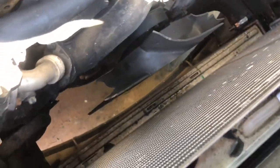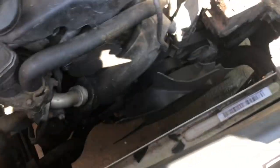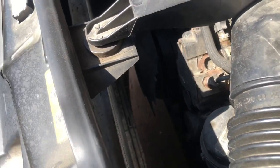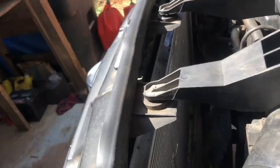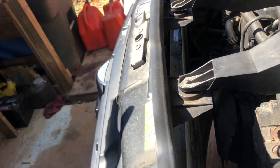Take a look at this, guys. Can you see what's going on here? No fan shroud. A lot of times I've noticed people have these fan shrouds zip tied, but that was not the case here. They're broken up and just kind of in there, and everybody thinks that's just fine and continues driving like that. But in this situation that did not work out. That fan shroud dropped down onto the fan, breaking all the fan blades, and in the process shooting one of the fan blades into the radiator, busting a hole. Now all of these parts are really expensive, especially when you need everything fixed right away.